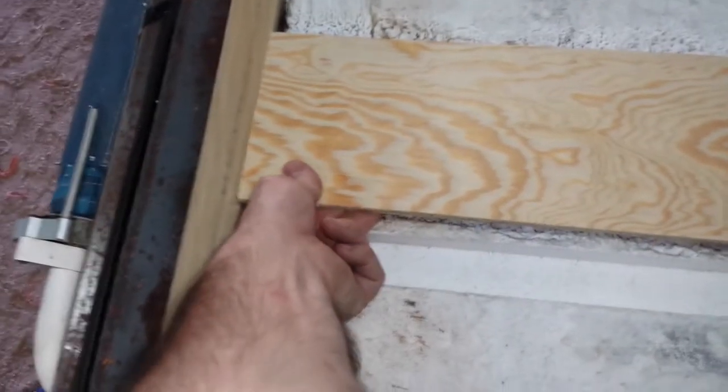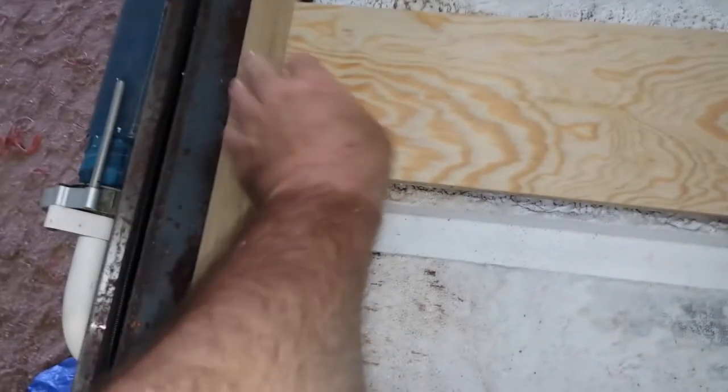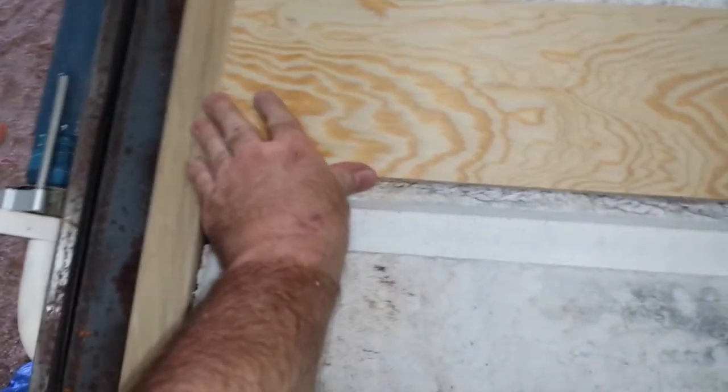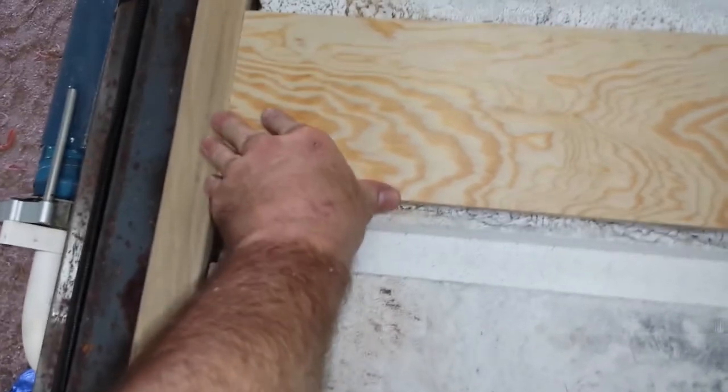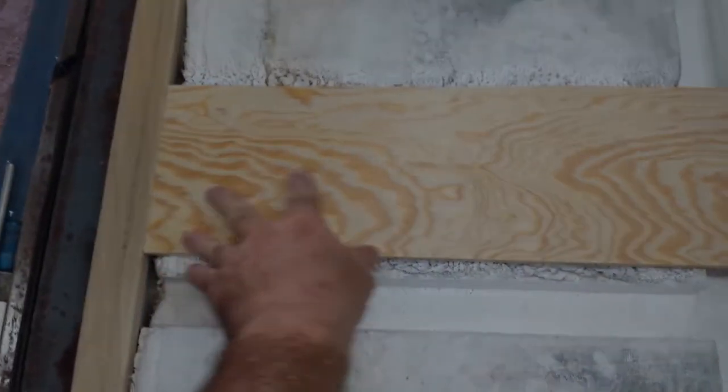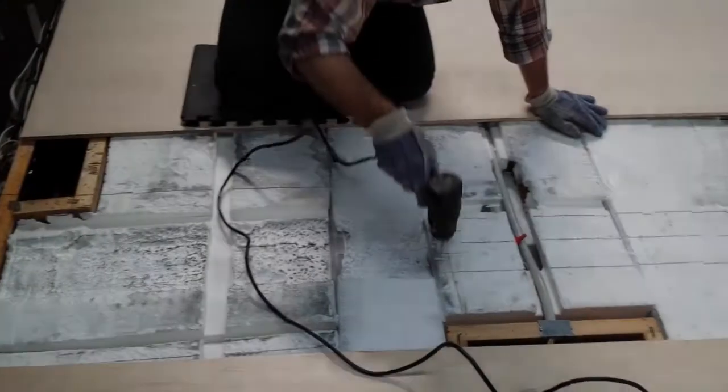That 3/8 inch strip is going to lift up the plywood roof. I have to somehow sink that 6-inch strip down into the roof so that it's not bulging up or pushing up the edges of the plywood or just lifting the roof up higher than it's supposed to be. Well, it's a styrofoam roof. I could have used a razor or some type of cutting tool and tried to cut a channel, but it's styrofoam. Styrofoam melts pretty easily. Why not just use a heat gun and melt down a little channel? So that's what I did.